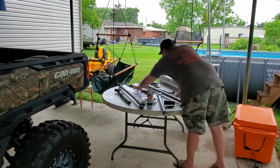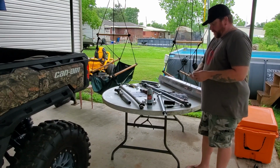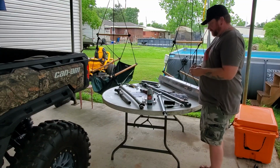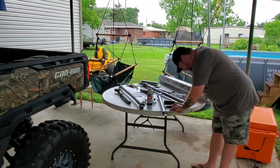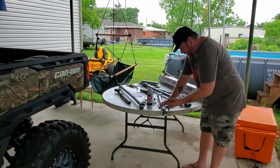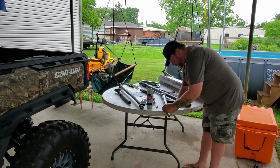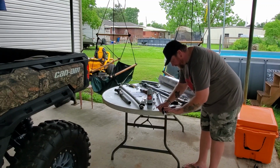And what we're gonna wanna do is, the kit comes with blue and green Loctite. So we wanna make sure it's dry. We wanna put the green around the shaft itself. Cut this little tip off. Looks like I need to sharpen my knife. There we go. So we're gonna apply the green sealant or holder liberally, boy, that's a good word, on this shaft. And then we're gonna kind of spread it around with our fingers, make sure we got a good even coat around it.